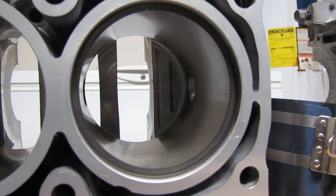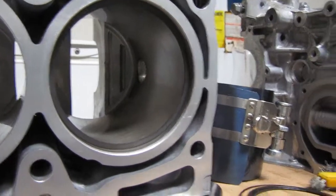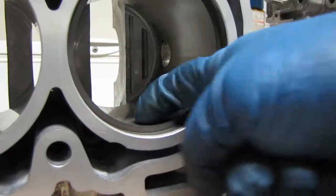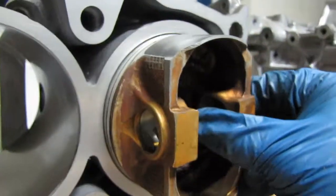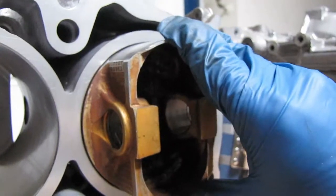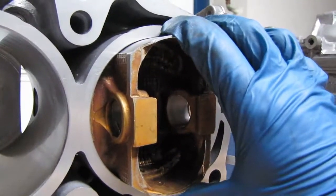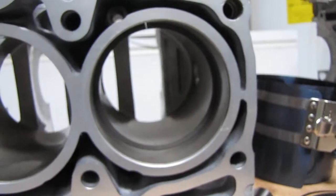I've got ring number two just set on the inside there. You want to make sure that it is square and towards the middle of the cylinder, because most of your movement happens right in here. So we take our piston and just go ahead and stick that in, feeling it to make sure it's about square and in the center. There is our gap, and this ring has its own spec: 0.37 to 0.52 millimeters. I'm going to go ahead and do this for all of them.